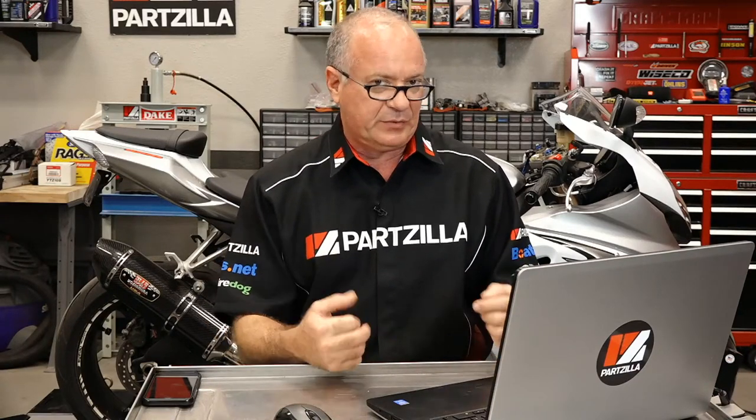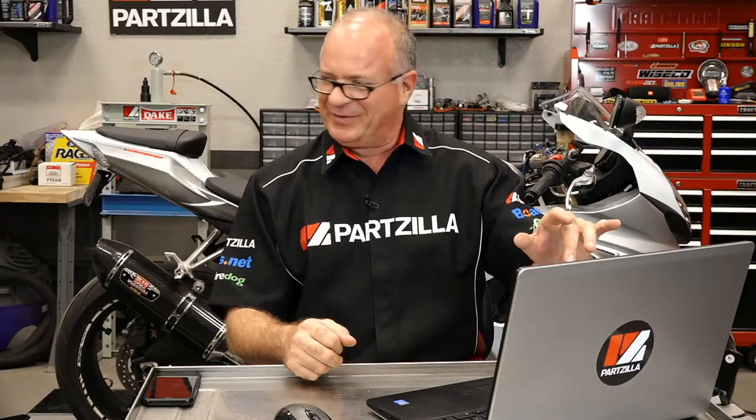Josh is asking me, he's got a 2006 250 EX, I believe that's a Kawasaki, or are you talking about a Honda TRX? At any rate, does the clutch need maintenance? Well, that's a kind of a double-edged question. As far as maintenance, do you need to adjust it every so often? Well, yes, because as a clutch starts to wear, its engagement point changes.